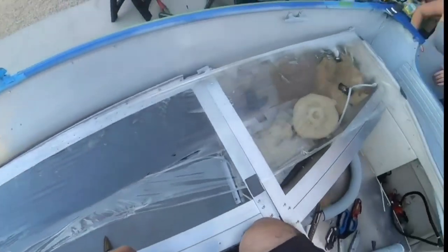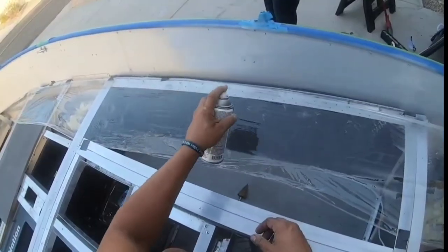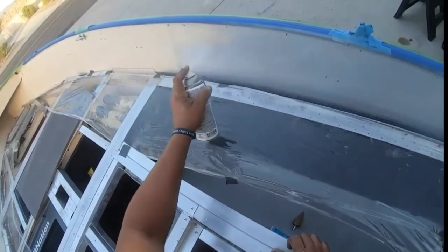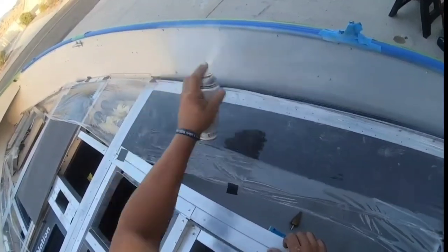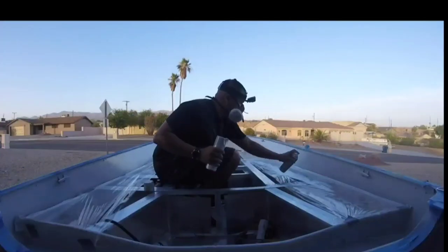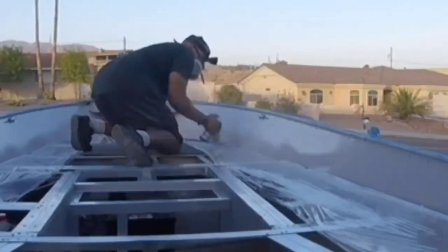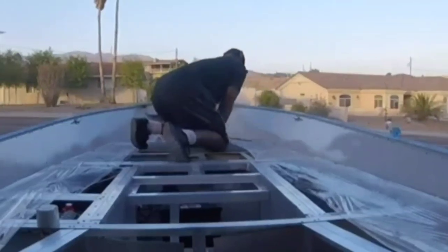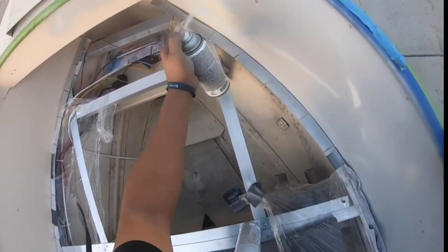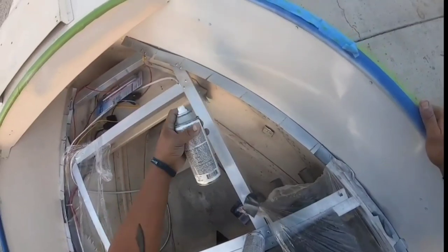In order to use the other stuff, we would have had to do more drastic measures, but we're already too far into the framing part. What you want to do in these sections is make sure the paint is wet every time you overlap. You can go up very smoothly, eight to twelve inches away - or six, depending if there's wind - up, down, up, down, making sure every time you're overlapping the paint is wet, or you'll have flash points where it looks really faded out and not glossy. We went non-stop with two coats of paint all around the entire gunnel. Also make sure you have a respirator - that's paramount. Even one of the cheap $18 throwaway ones from Harbor Freight will actually do the job.